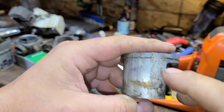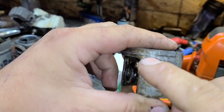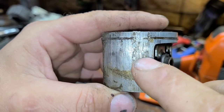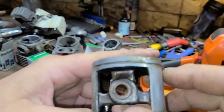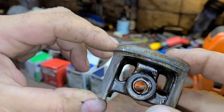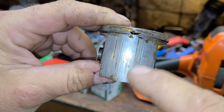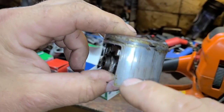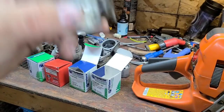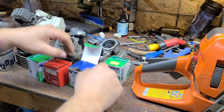You know when you pull a saw over and it's got zero compression — look at this. This is a good example. This saw has been straight gassed, run super lean, it gets hot and actually melts the piston and closes the ring groove. The ring is stuck on the back and it's stuck in the front. Scoring on all sides — this is not the worst example. This scoring on all sides of the piston is generally from being straight gassed.